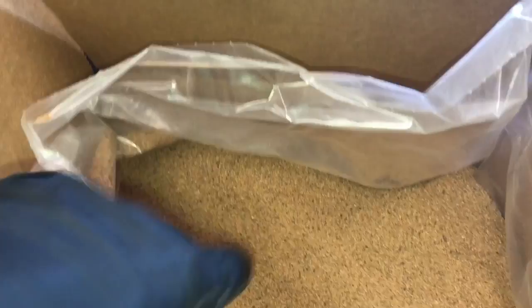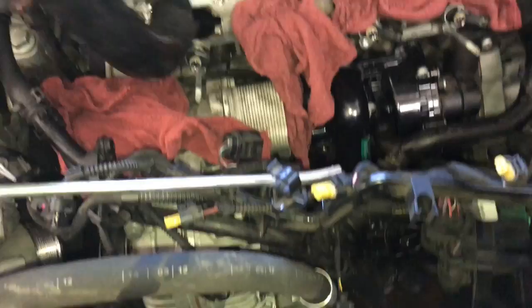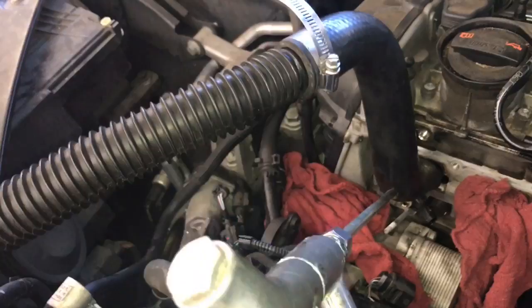The cabinet comes with the gun with the hose like this, and I'm going to use my shop vac, and I made a little rigging here out of a radiator hose, and I've cut a little slit in it like this, and it's the perfect size to fit right into the port here. Then on the back of the elbow here, I drilled a hole in it, and what you do is you insert the gun through the hole, and then you insert the whole hose and everything into the port, and then you slide the gun through, turn on your vacuum.